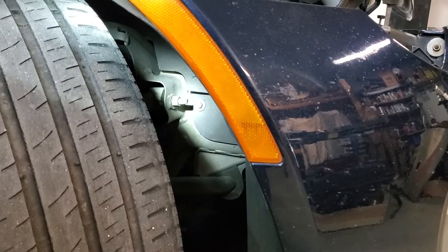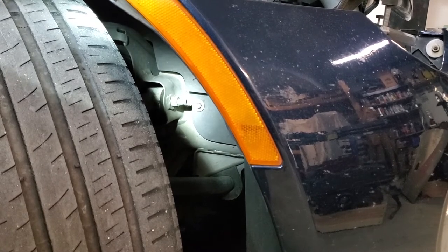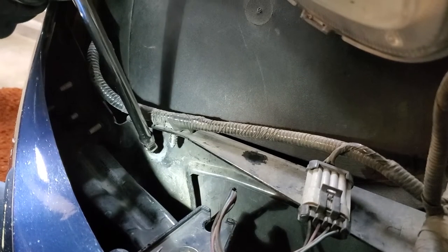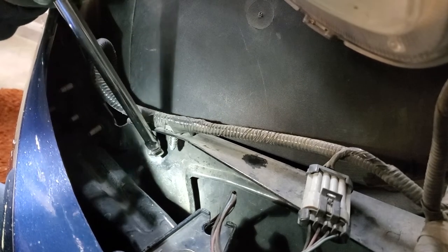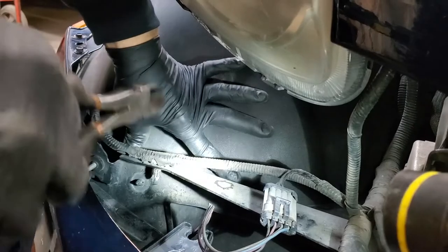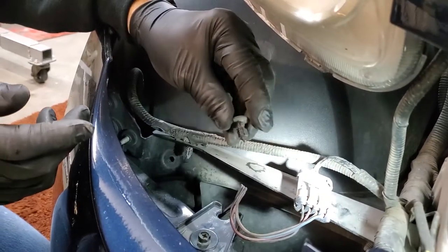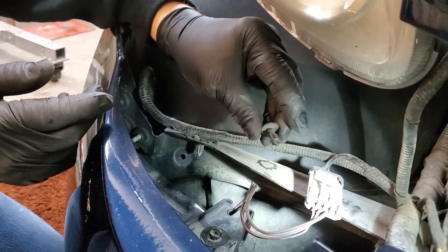Here's the other bolt. Now that we've rotated the wheels to the passenger side, it's going to be 10 millimeters also. Front 10 millimeter bolt is now removed. This Christmas tree fastener is holding the wheel well in, so we're going to have to get that out. These are available — we'll give you the part number. There should be a Dorman part you can pick up, because these are really supposed to be a one-time-use fastener. Found a way to get it out — you can see how used it is, so we're going to get a new Dorman part.